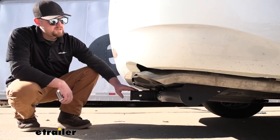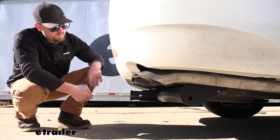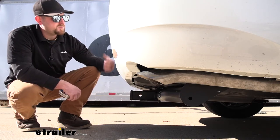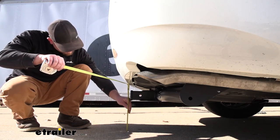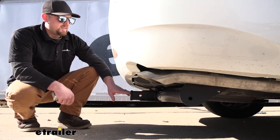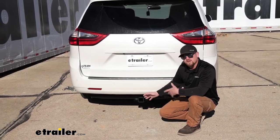To help give us a nice appearance, the hitch is going to sit back a little bit, and we can take a couple of measurements to make sure all of our accessories will work with it. From the center of the hitch pin hole to the very edge of the bumper, it's going to be right at 5 inches — useful for figuring out if folding accessories can be stored upright without contacting the bumper. From the ground to the top inside edge of the receiver tube opening is right at 12 inches, which helps figure out if you need a ball mount with a drop or a rise. At that measurement, chances are good you'll need a ball mount with a slight rise. Overall, a hitch you really can't go wrong with.